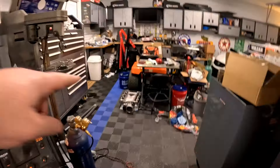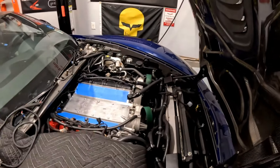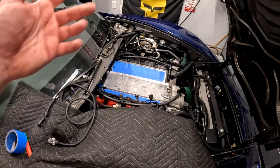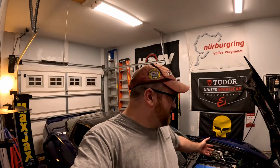Alright guys, you saw us pretty much tear everything down - we just got the supercharger off; it's over by my welding table. We've got approximately half the list crossed off. The rest is basically remove the power steering pump, take the valve cover off, rockers, push rods, rocker stands, and then get access to the head bolts and pull it off. I did look down the intake port on cylinder number one - didn't see anything, no coolant. When I pulled the supercharger off and the bricks off, there was no excess coolant up top, no leaking bricks. So it's got to be something down in the combustion chamber or inside the head.